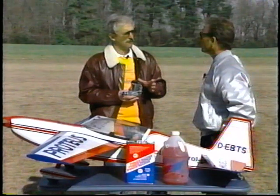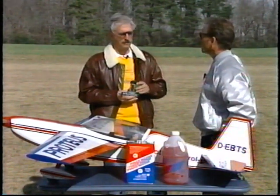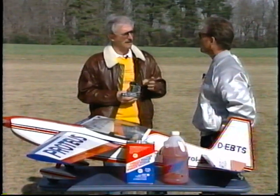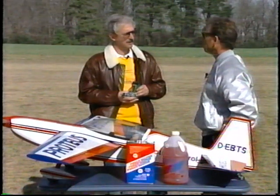Generally, that's a good RPM range regardless of nitro and prop. Try to get, for example, a YS around 8,500 to 9,500 RPM. No higher than that. It's very, very hard on the engine.